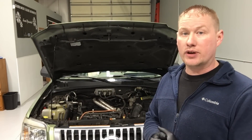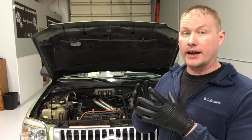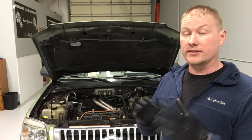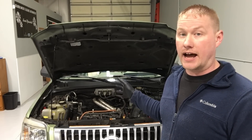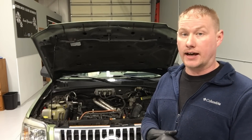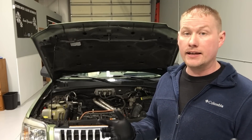Today we're going to show you how to change your transmission fluid in the eCVT transmission found in Ford Escape and Mariner hybrids 2005 to 2012. These are CVT transmissions — there are no clutch packs to drop clutch material, but the fluid is still breaking down over time with heat cycles and not protecting critical wear areas. The most common concern is bearing noise from fluid breakdown because no one changes it. You want to change the fluid every 60,000 miles. The procedure only takes about 15 minutes, no special tools required, no jacking the vehicle up, and no special fluid — it's a very simple, cheap process.